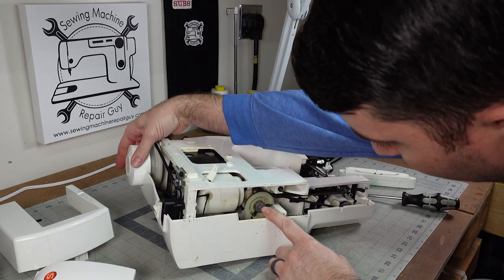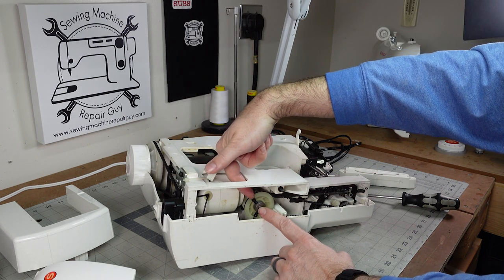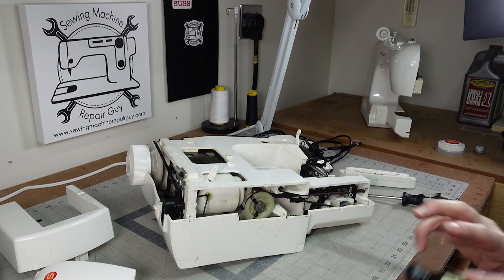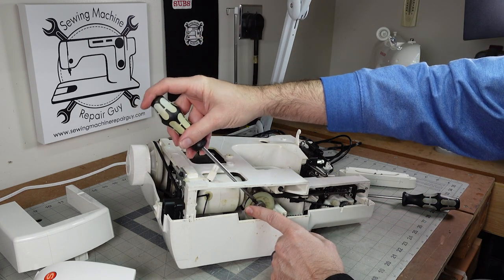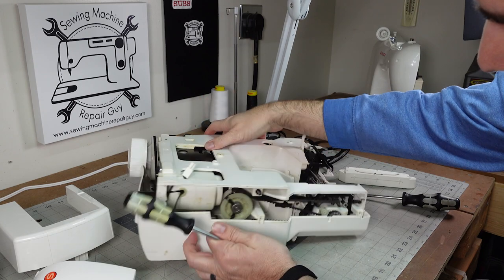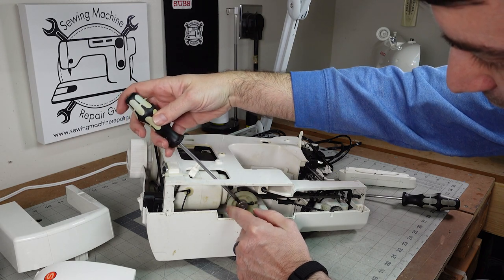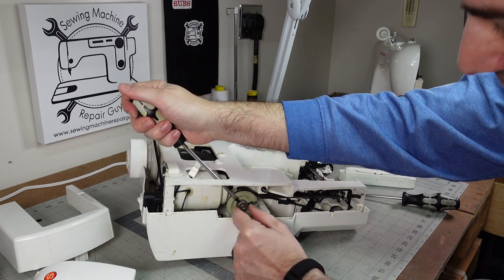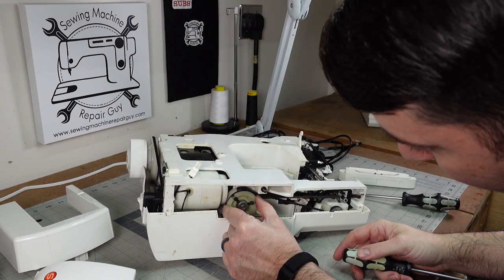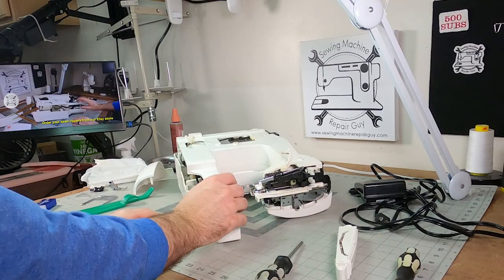Here's one place where you can do the timing adjustment. Looks like I've got a straight shot through here with a screwdriver. You just have to be careful — wherever you're adjusting, make sure there aren't flat spots on the rotor, which means it's the only place these screws can be. I don't see that in this case, so that rotates freely. Now I'm moving the hook over here.